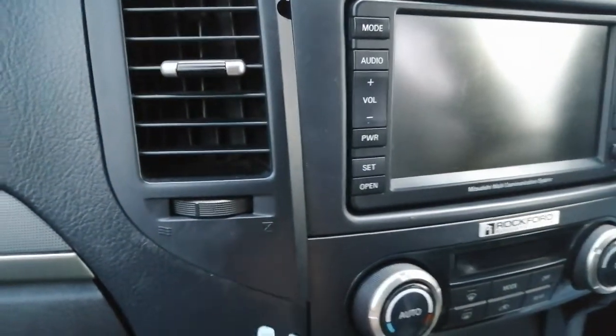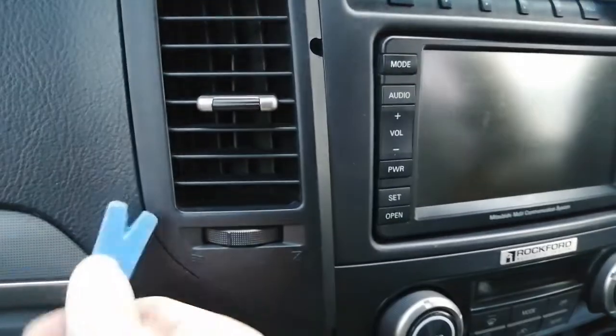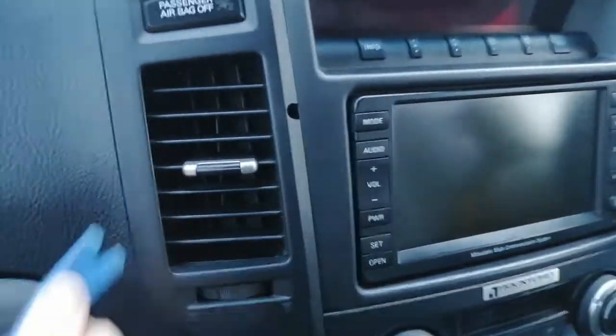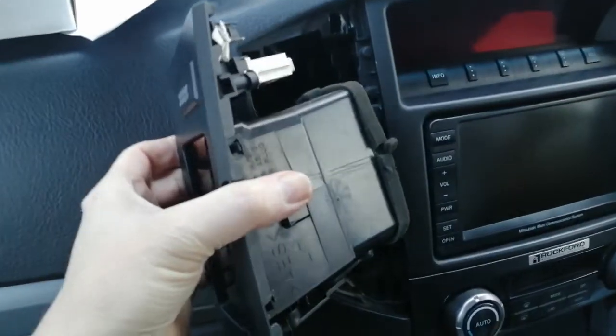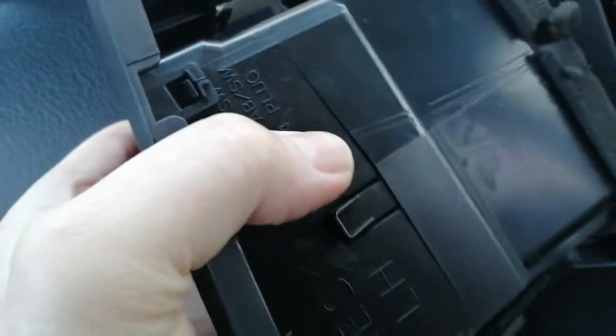This particular vehicle looks like somebody's quite ham-fistedly had a go at this in the past. When you lever these out you've got to be careful you don't snap this front fascia away from the grille. It just sort of pops all the way around — normally work at the top here as well. You hear the click? We go around it, ease it out, and draw it forward. It's got plastic lugs that click it in, and as I was saying somebody's broken all the little lugs that hold the sides, and the other side's broken as well.